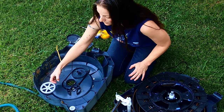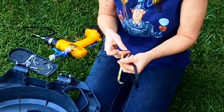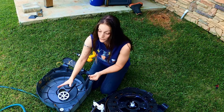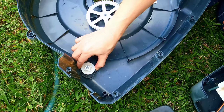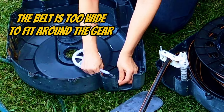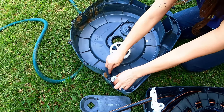I'm going to take this aftermarket belt — it should fit nicely on here. Unfortunately it is too wide: this is about 5 or 6 millimeters and the replacement is about 10 millimeters. So I need to slice it in half and then it should nicely fit onto these grooves. The other thing is it's going to be too long, so I need to cut it so that I can appropriately size it. I'm going to loosen the spindle up a bit so I can lift it up enough to get the whole belt underneath it.